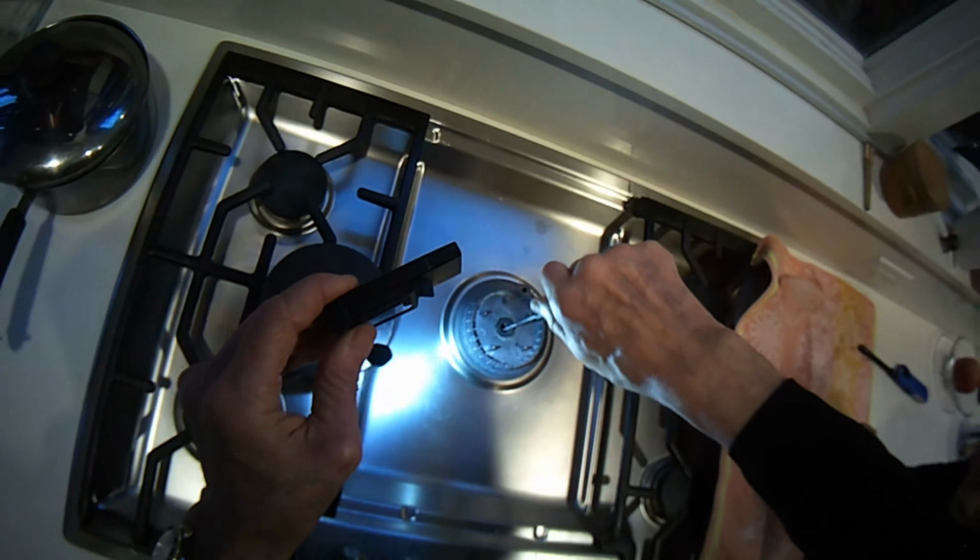So if you have a weak flame or you have clicking and no ignition, you probably just have to clear out that little hole with an extended paper clip or the tool that we have in the link in the description below, and that's going to get your burners running really great. They're going to light fast, and they're going to give you a big flame like we see here. So it's a very quick and easy fix. It'll just take you a couple of minutes.